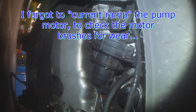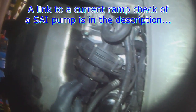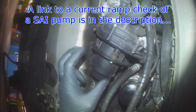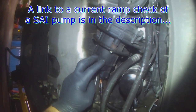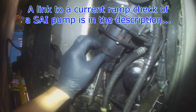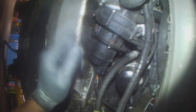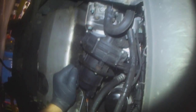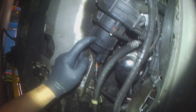And like I said, that's the way to most accurately check the system: with the engine running, diverter valve open, run the pump so that it forces air into the exhaust. If you don't see any huge number changes in your short-term fuel trim, then there's plugged passages — air is not getting into the exhaust, be it the diverter valve or the cylinder head plugged up with carbon.